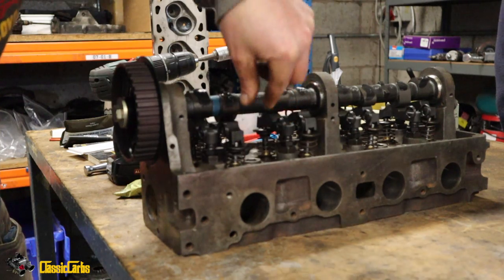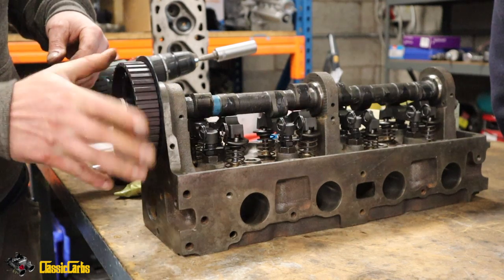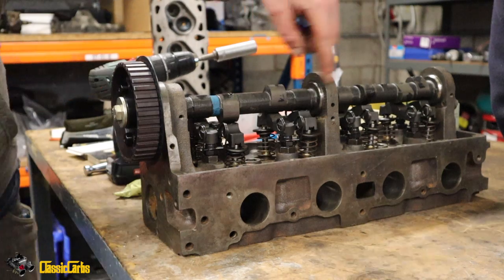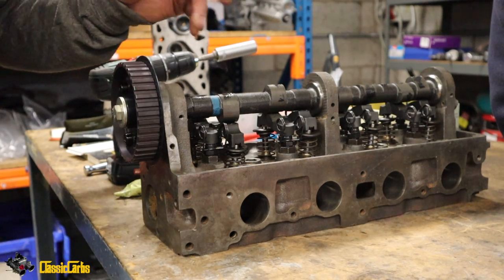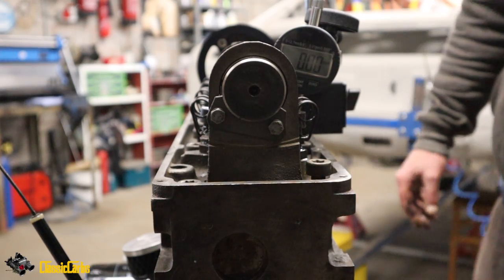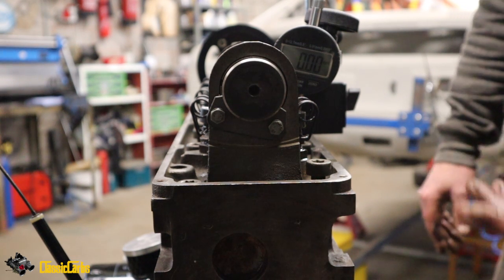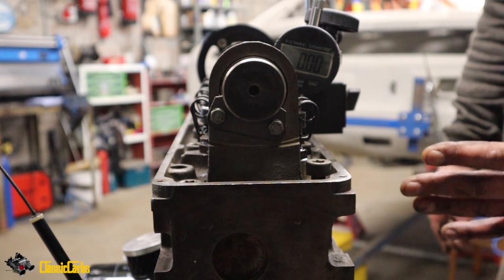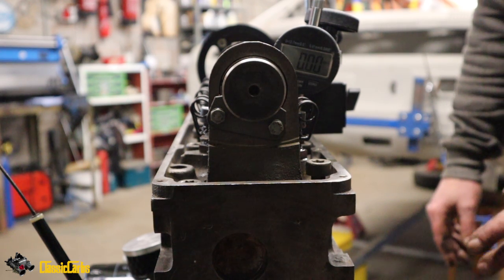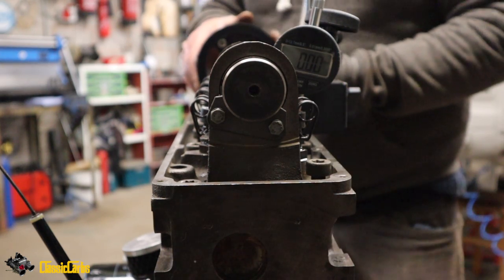So the valves are very light and easy to move, you can do it by hand basically. What I haven't done is set the clearances a bit more, so they're a bit more realistic. Right, okay, so what we've done is, guys, we've just briefly put the head on the block and we found that the exhaust valves are too close to the piston. So we want to check that the geometry is sort of right.